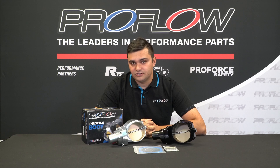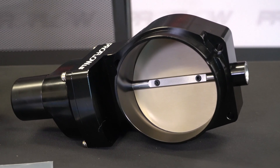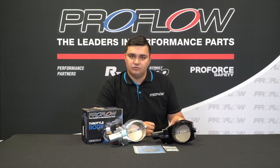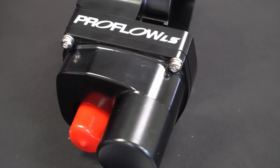Another unique part of ProFlow's design is that these throttle bodies incorporate a stepper motor. That means they can suit both boosted or aspirated applications, so regardless of what combo you're doing — because an LS can be pretty much anything these days — they should suit. Now, speaking of suiting, these will bolt to your factory manifold or an LSX or any other type you have, but do bear in mind if you bolt these to a standard car, you're probably going to need a retune because of how much more air they do flow.